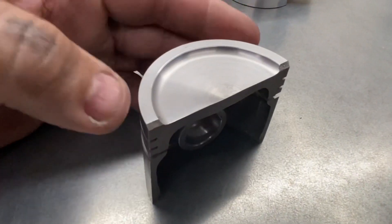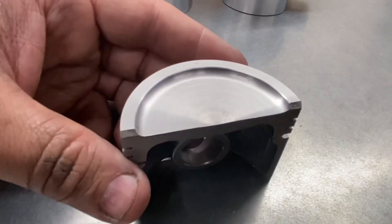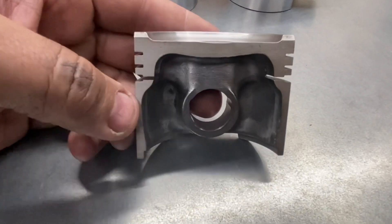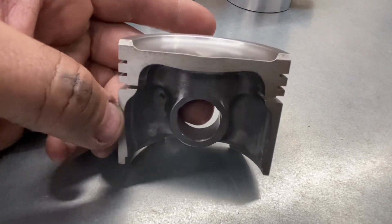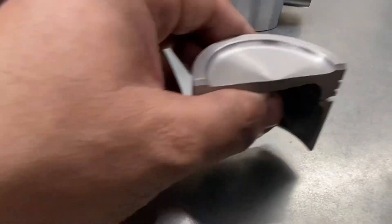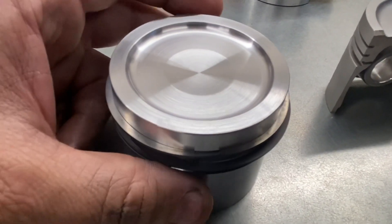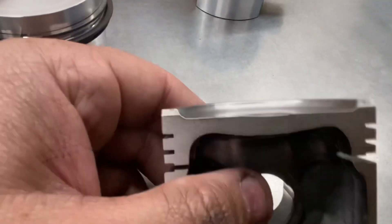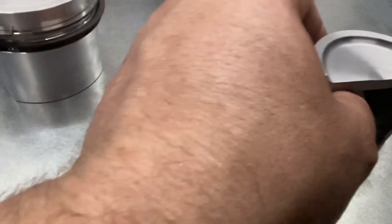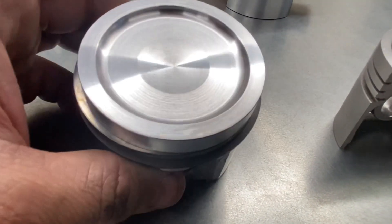If we hadn't machined off the 88 thou, that would have given the piston dish volume on this particular piston of about 14.5cc. So these 21253s will stand a fair bit of dishing, which is very useful for engine builders — if you've got an engine where the compression's too high, dishing these pistons out is relatively easy, straightforward and reliable enough to do. The dishes we've done here — having only taken 35 thou off the crown and then machined down another 141 — means we've got pretty much the original thickness of the piston left, so in reality what we've done here won't affect the piston strength in the slightest. It's a good modification to be able to do.